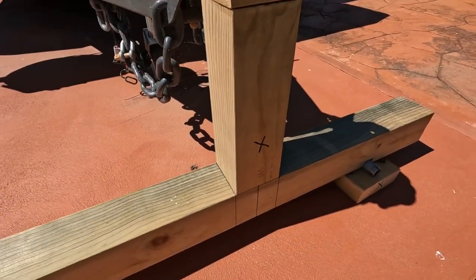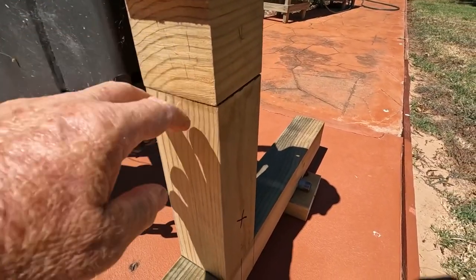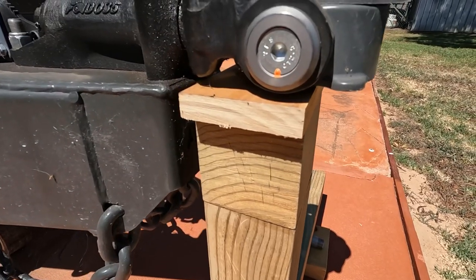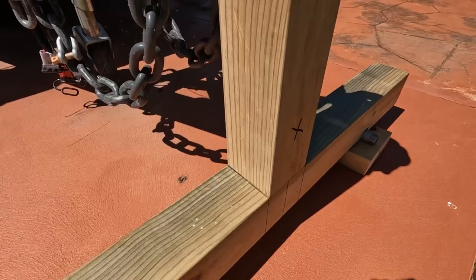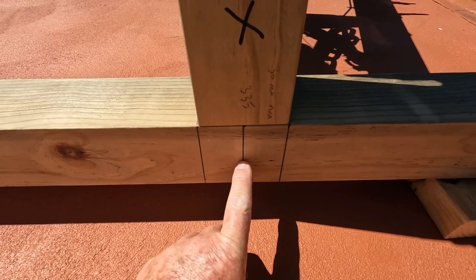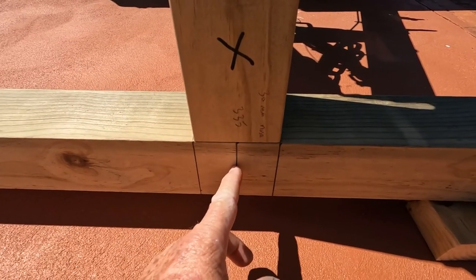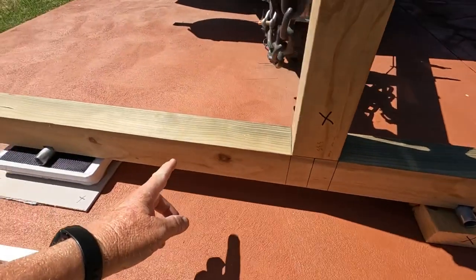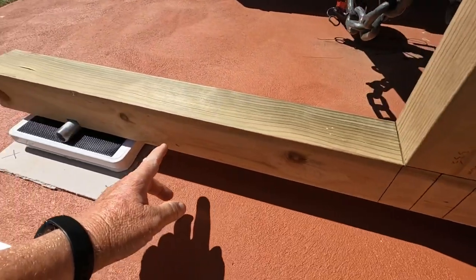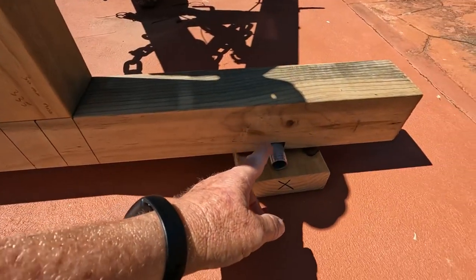This other piece of wood I've got here, I've put underneath the hitch here, which has a couple of little bits of blocks in there - I didn't have a piece the same length as what I needed, so I had to just block it up a bit. I've got that set up so it supports underneath that hitch. Now, the other part that's important is this centre line, which we talked about in the shed. There's the centre line, and I've just put another marker either side so I can line up this piece of wood. When I say that's the centre, it's not actually the centre of the whole piece of timber - it's just the centre line that you measure from to get the correct length to your piece of pipe. Remember, two feet that way and a foot that way.